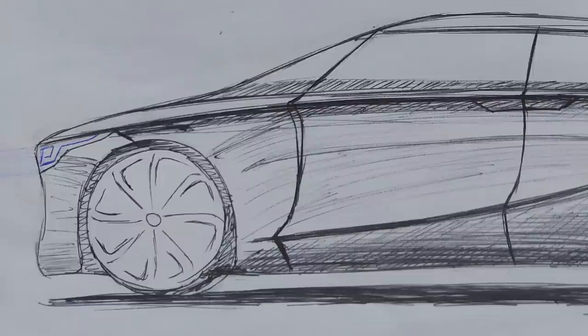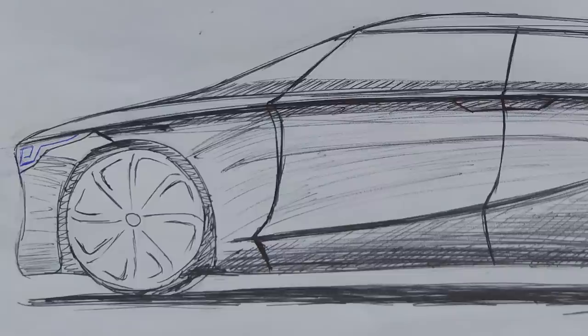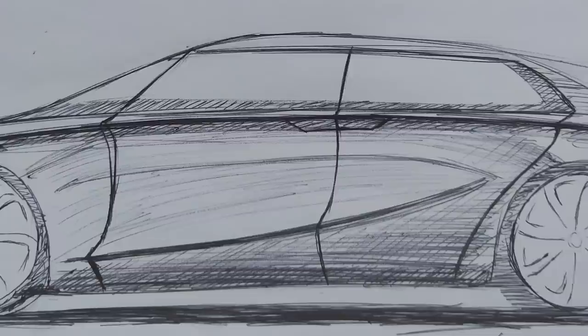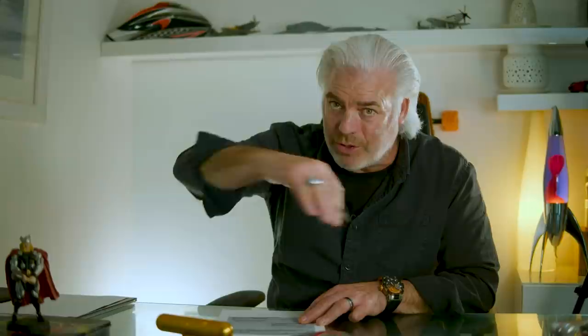You have an extremely short overhang in the front. That might be your intention, but it means there's very little plan view to the front of the vehicle — it goes out slightly from the front wheel then straight across. The base of your windscreen is almost directly over the center of your front wheel. Your A-pillar and the centerline of your windscreen come almost to a point, which means you have no curvature in the top of the windscreen — just a straight line through the vehicle. That is not good. You want curvature in the glass, if only for good aerodynamics.